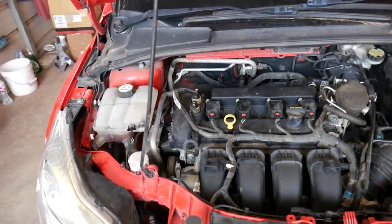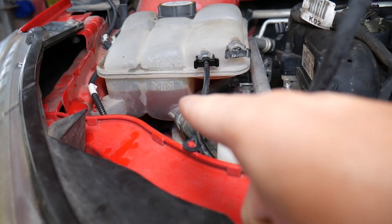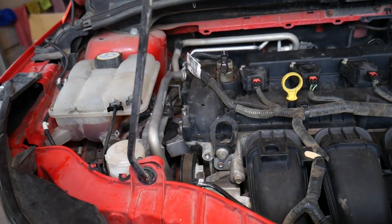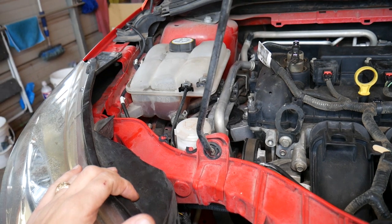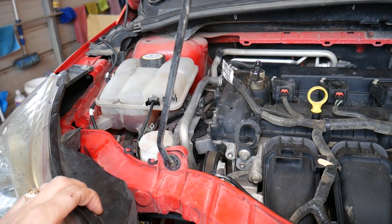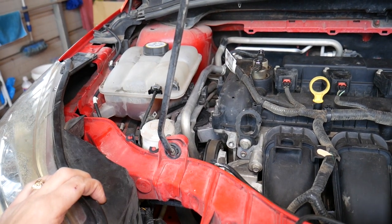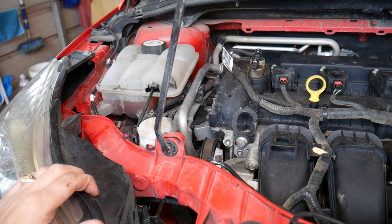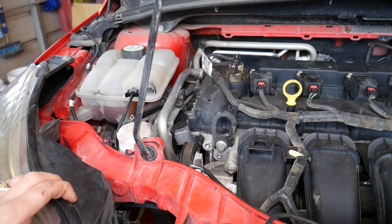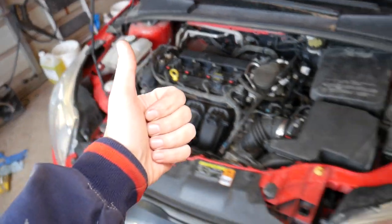While you're revving it up, always have a person outside to make sure all the coolant didn't go into the engine. You can see our level decreased significantly but we're still close to the minimum mark, so we're fine. For the next step, you can take it for a test drive if the coolant looks good, but I recommend letting it sit overnight. Once warmed and turned off, let it sit for one night — it's going to take even more coolant. Next morning, add coolant, check everything, make sure you don't have any leaks. Then drive the car a short distance, keep an eye on the temperature gauge, and make sure you don't overheat. If you start overheating, repeat the procedure. That's the whole procedure — hopefully the video is helpful. Thank you for watching, please subscribe to the channel for more videos.